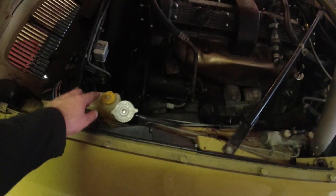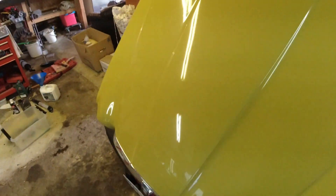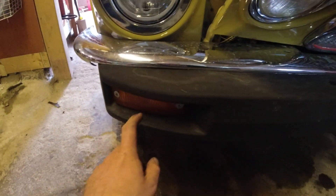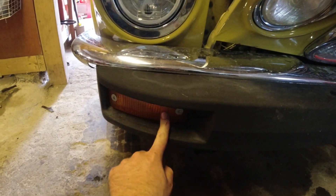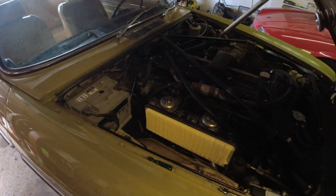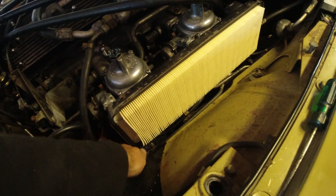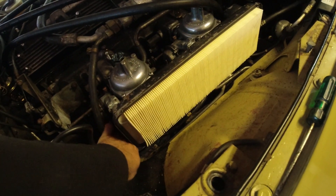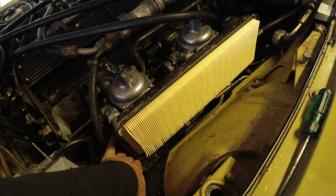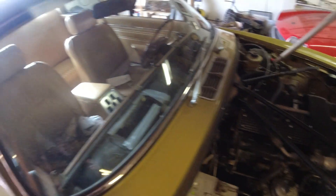What's left to do for the test: connect the hose so we can wash the windshield, check the horn - I don't think it works. Windshield wipers work. All lights work except for this side marker right here, so I'll take the screws out and see what bulb is in there. I need to bolt down the battery. This fuel line I'm probably just going to connect with a zip tie so it goes away from the heat - that's after the fuel cooler. Seat belts are now sorted.